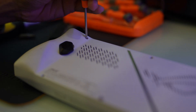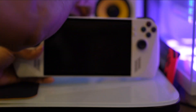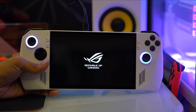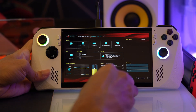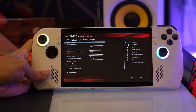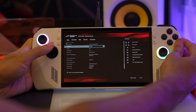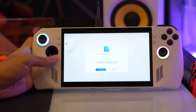And there you have it — you've just successfully replaced your SSD storage. We're now at the final stage. With the new SSD firmly in place, it's time to bring your Asus ROG Ally back to life. It's crucial to plug your charger back in before hitting the power button. Your device will initially launch into BIOS mode. Tap on Advanced mode, then tap Advanced again, then tap on ASUS Cloud Recovery, which allows you to install Windows 11 and all drivers on your Asus ROG Ally without any hassle. Once you tap on it, go through every step of the installation process.